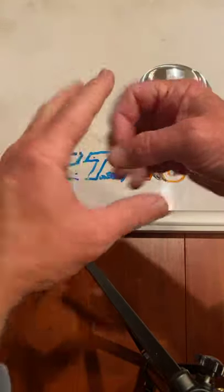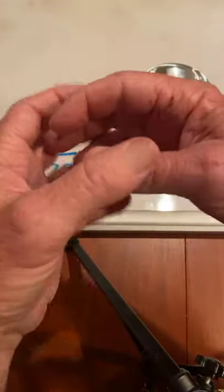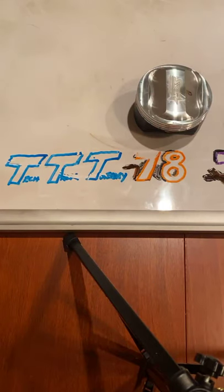Because it's going clack, clack, clack, clack. And it has springs in it to where if you really load it, it can jump over a tooth. But you want it under normal conditions to have room to move. If you put a solid compensator on the front or a compensator eliminator, you have taken all that away. And if you have to put a compensator eliminator on there, please use the stock gear ratio size.